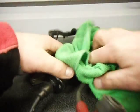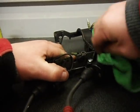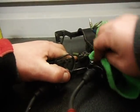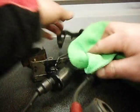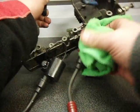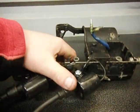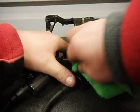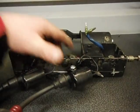We use these — they're like a screwdriver ratchet. A good reason is you can do bolts up tight but don't wrench them up. Do that little bolt up as best as you can. Try and keep these as uniform as possible — it just looks better if they're all sat in the same orientation. Once that's tight, wipe off any excess with your rag first, so the grease is where it needs to be. Give this again another little bit of contact cleaner — that will clean most of the excess grease off.